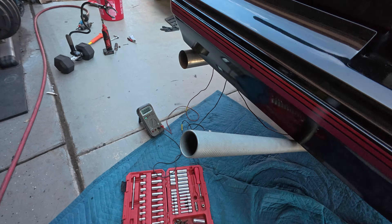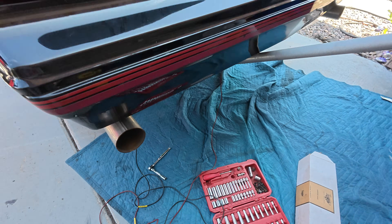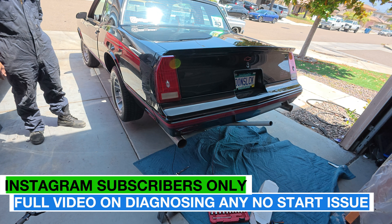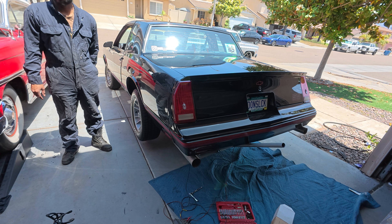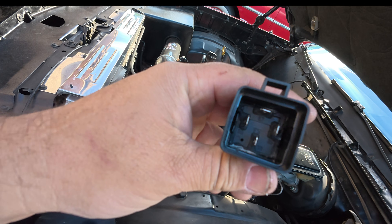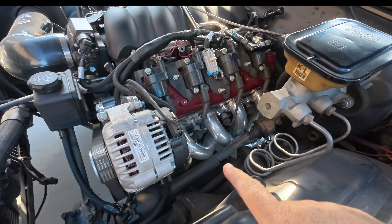Before we even say we're good, I'm going to go ahead and try to fire up the car. Obviously it's fixed — that was the only issue we had. For all my subscribers, I will be doing a longer video covering everything for a no-start issue — how to diagnose spark-related, air-related, and fuel-related causes to cover your basics. We ended up figuring out the relay was bad. The fuel pump wasn't coming on because the relay was bad. I tried to open it up for you, but it's glued on there. All you can see is some burnt contacts right where they touch — carbon buildup where it wasn't making good contact.